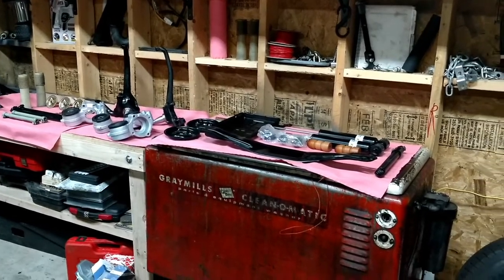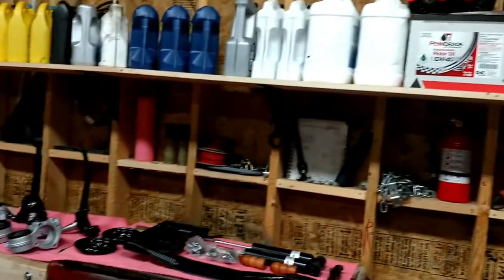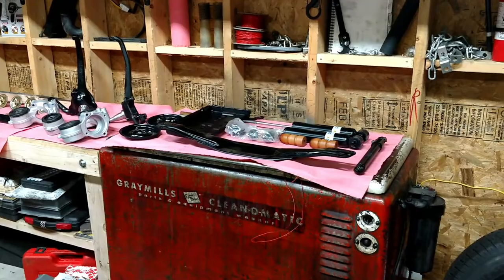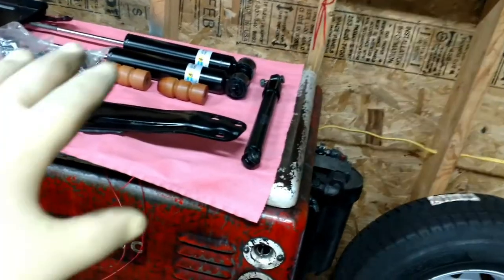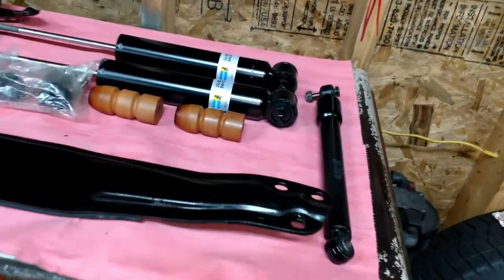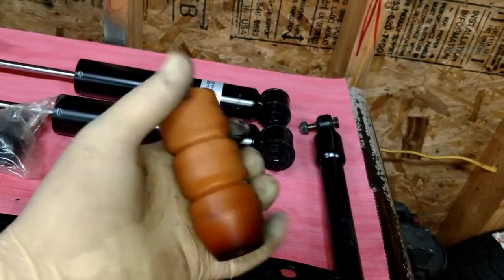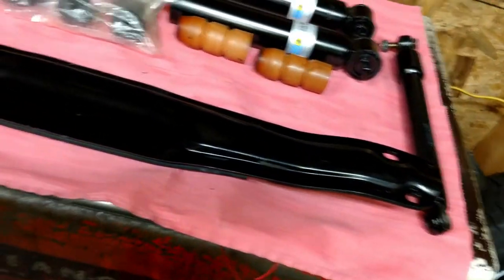Here's part two for the 1982 300 SD — you can see it's up here on the lift. It has no suspension anywhere. For the last day and a half, I have totally cleaned and prepped the original Mercedes parts. I've actually started getting in some new parts — there's the steering shock, and there's the rear Bilstein shocks. For the front shocks, here are the bump stops — these are the original ones from Mercedes, they're in excellent condition, absolutely nothing wrong with them, so I'm going to reuse these.